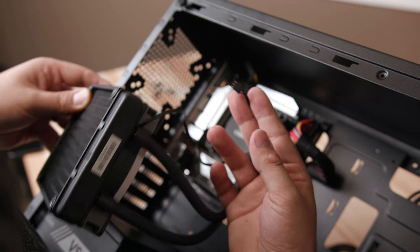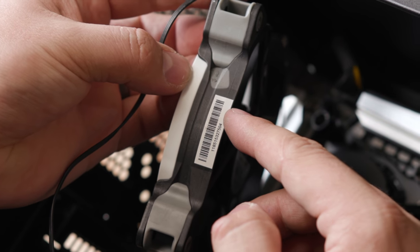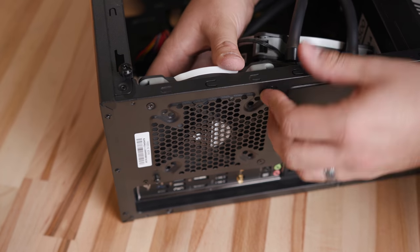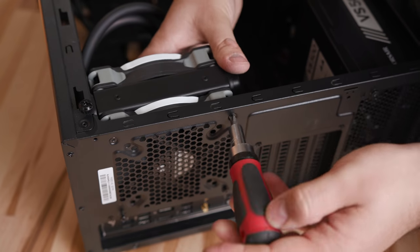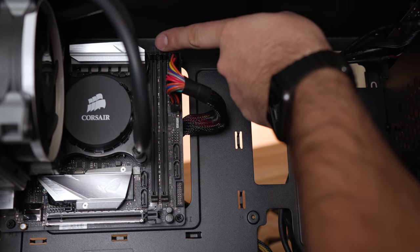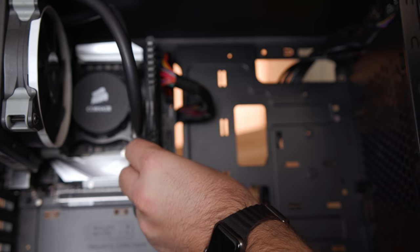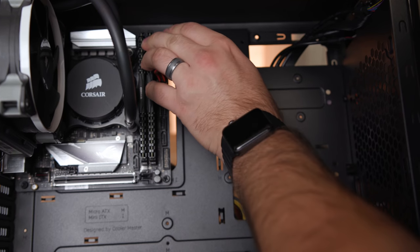Now we're going to be plugging in our fans on the radiator for the water cooler — I'm plugging mine in at the top left-hand side. Pay attention to the airflow; we want it sucking air and pushing all that hot air outside of the case. Get your fan aligned and put the bolts into the slots to hold the fan, then attach the radiator and the other fan all at one time so the whole assembly is held down by the rear screws at the back of the case. That secondary fan plugs in right below the M.2 SSD cover. Now let's insert the RAM — open the two clips at the top, and the RAM sticks will only go in one way. Apply even pressure and the top clip will automatically close once the RAM is inserted.